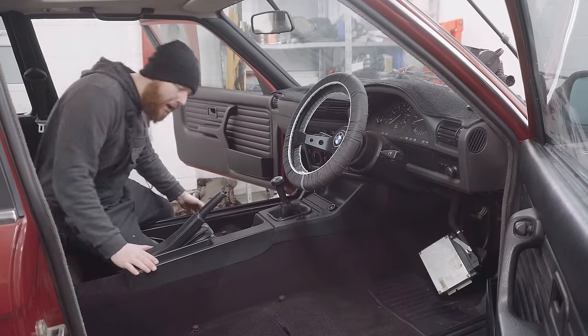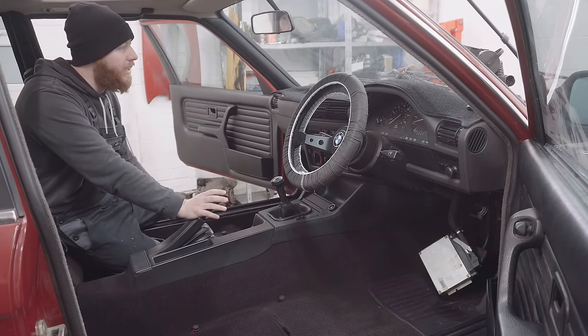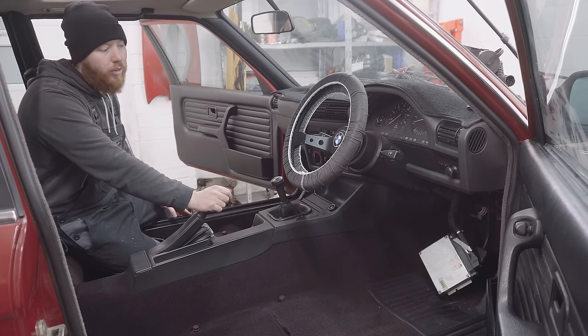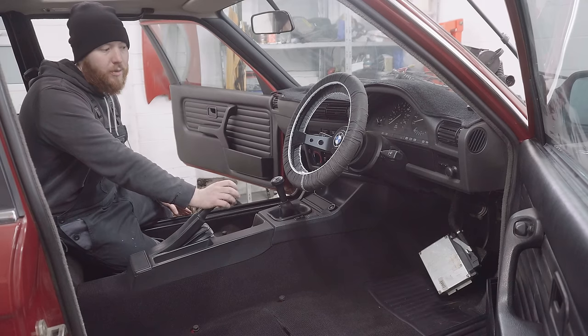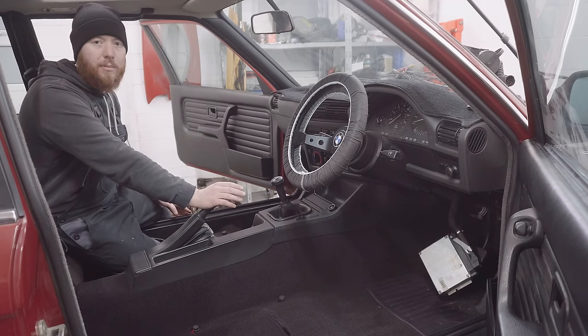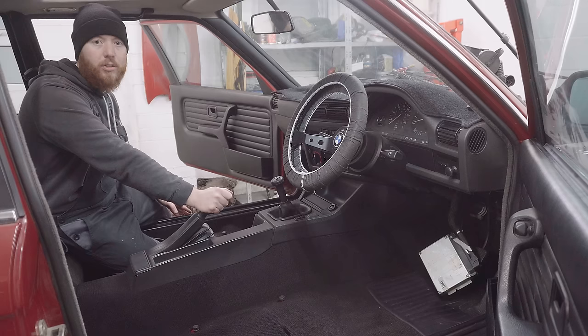Okay, so short of adding petrol, the only other thing I can think of is the ECU. If you remember back to when we did the M52 wiring video, the car was actually, at the end of that video, cranking quite well on the key with this ECU plugged in. Now, this ECU, it's an MS41, but it's not index 10 or index 11, which from my understanding means it's not at all editable. So I was expecting it to still have EWS enabled. Somebody enlightened me in the comments of that video and said that the EWS doesn't actually prevent the car from cranking, it only prevents it from sparking. So it cranking on the key with that uneditable ECU isn't actually unusual.